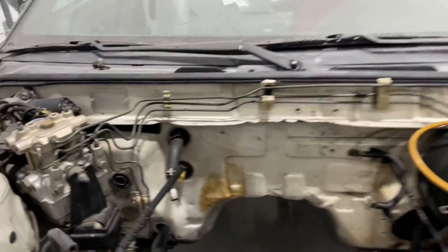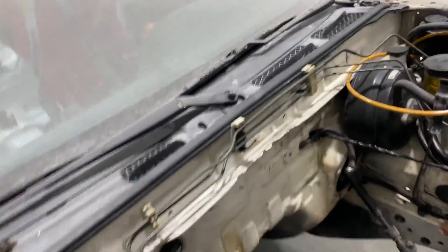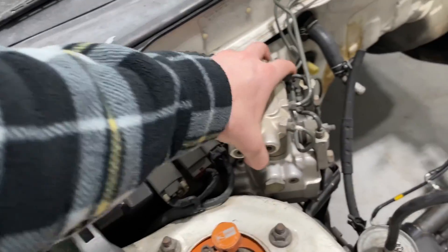I got the fluid out of the reservoir. I'm going to pull the lines off the master and pull the bolts out of this ABS unit. Your master cylinder is labeled — the front is the rear and the back is the front, which is kind of stupid, but that's just the way Nissan did it. You got this bolt down here, and then there's two up in the wheel well. Then you take these connectors off and pull this whole thing out. We're going to pull a line off the rear junction block, pull a line off both calipers, pull a line off the master, take the bolts out of the ABS bracket, and pull it all out as one.